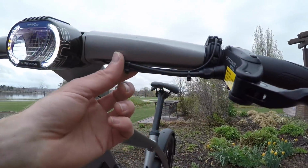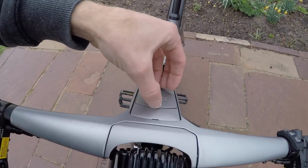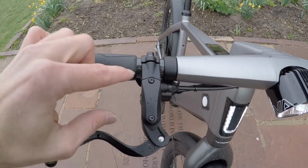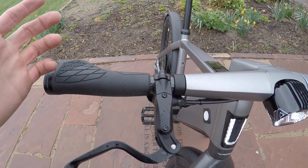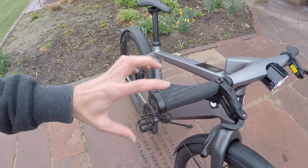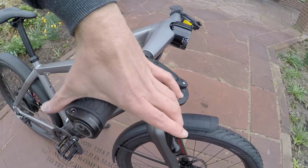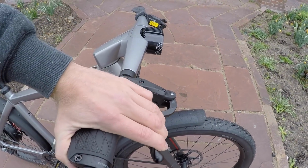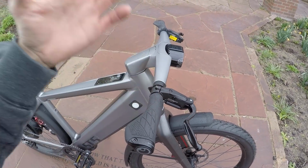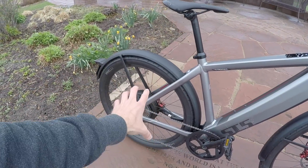They sort of enter into the base of the handlebar. Yeah, so this is aluminum alloy. Then we've got some plastic right here, and this little flap removes, and that's where you can mount a phone if you want to. And we've got carbon fiber inserts for the handlebars. Nice Ergon GS1 ergonomic locking grips, high performance, quality stuff. TRP, these seem like 3, maybe 3.5 finger brake levers. They are adjustable reach, being hydraulic, and having brake light activation and regen activation.